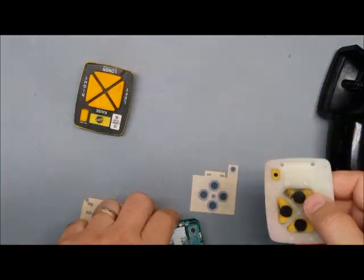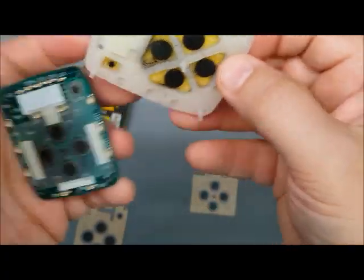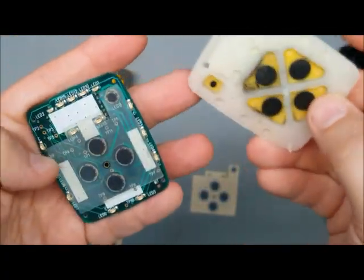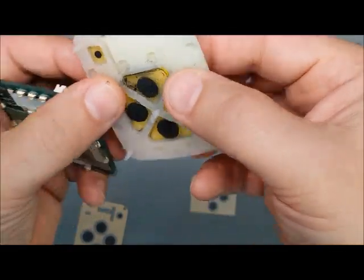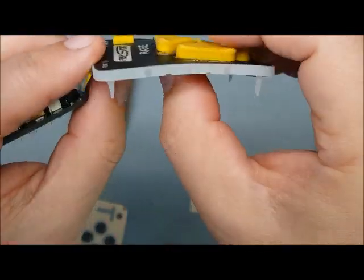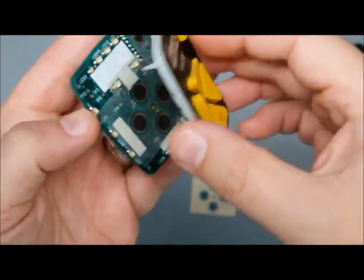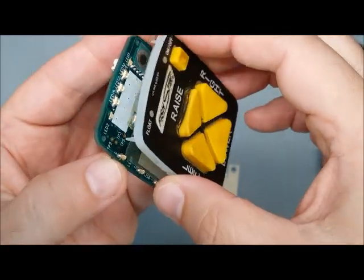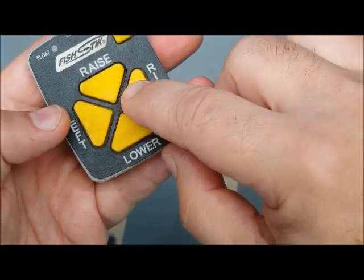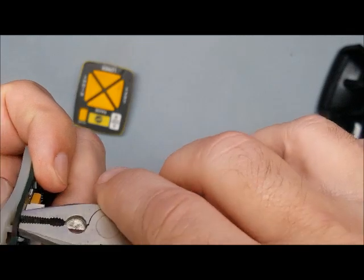This version is a little bit harder because it has five pins and the middle one has a little nub that sticks in when it seats. I also wanted to point out that this one was really worn out — the rubber is ripped. Without the button working properly this is basically useless because the button gets stuck down and shorts itself out. However, with the membrane repair pad that problem is addressed.